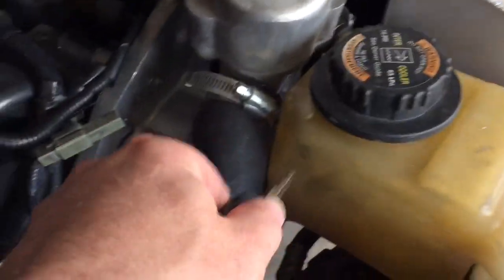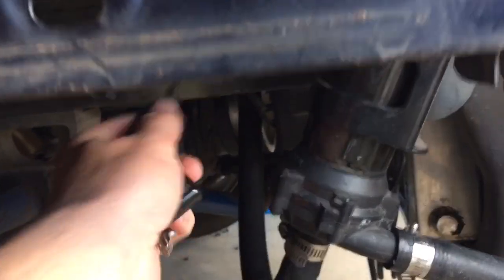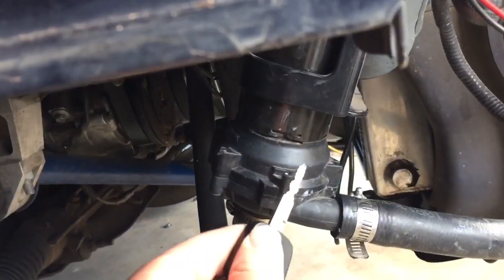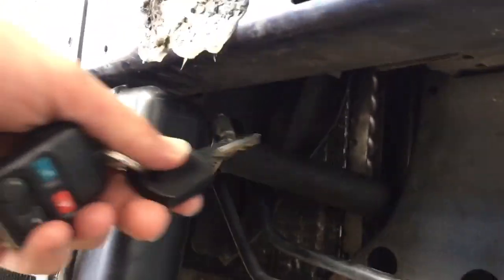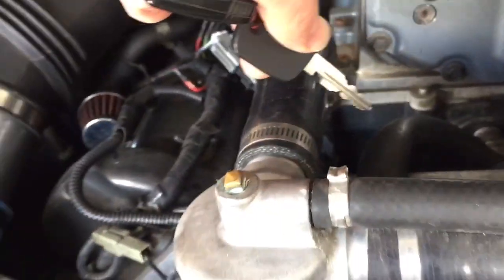The water goes out the bottom, gravity fed to the intercooler pump, which is right here. It comes down that line — this is the line from the expansion tank into the pump. This whole unit is the pump and it swirls it around and takes it over to the heat exchanger. On the other side, there's another hose that comes out the top, and that hose comes up over to the bottom of the intercooler. You can see it's the bottom one there — it goes into the bottom through the intercooler and then back out the top one and to the expansion tank. So it's just a big circle.